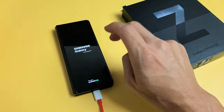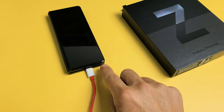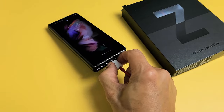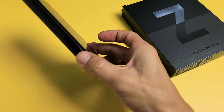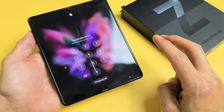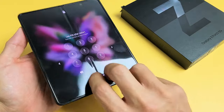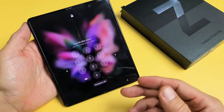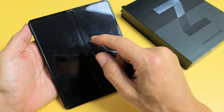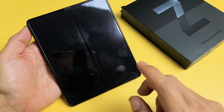If you're still in there, then we're going to go to the next possible solution. Go ahead and unplug your phone. Next thing we're going to do is open up the phone, and what we're going to do here is what I call the tap method. Hold the phone with two fingers, and tap all over the screen and all over the back. It's possible that you may have something that's slightly dislodged, even maybe a ribbon band that's slightly off, and a simple tap can pop it back into place.